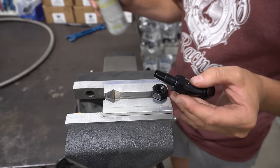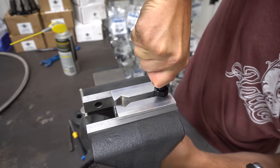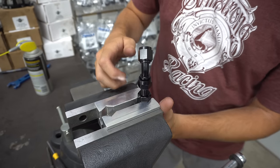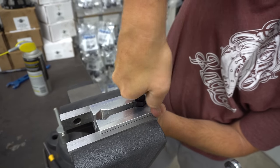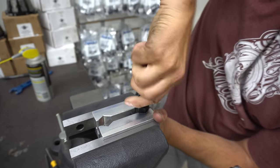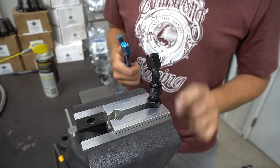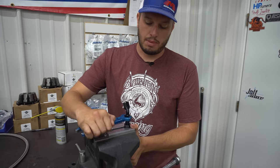Now that we have a clean cut, we're going to push this into the back side — you can actually see a ledge down at the bottom of the threads. Push the hose, you can twist it slightly if you need to, right to the bottom. A nice square cut is necessary; if it's cut offset it's actually going to hang up on one side and sit down on the other, making it difficult and creating a worse seal. At this point we're going to put it in the vise — I'll do it vertical so it'll be more visible.